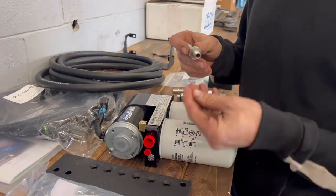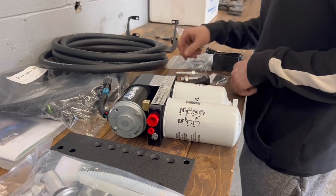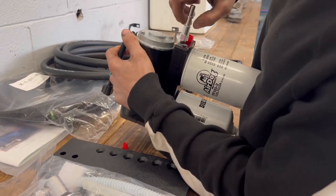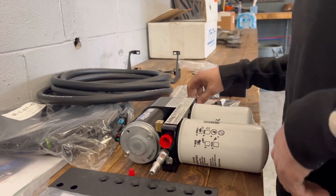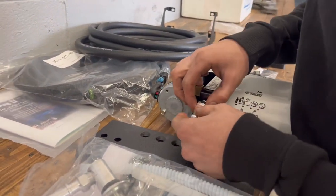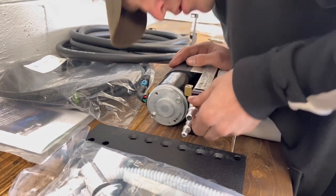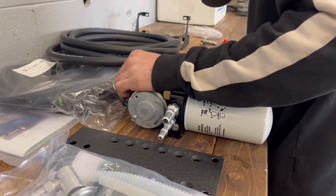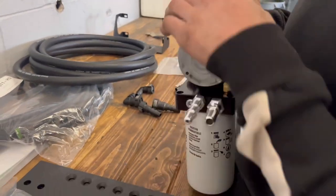First thing — don't lose this. I've lost a couple of them. Put your washer on there and go to your injection pump. Take off all the little inserts, screw this in. You run this one to your engine — keep your hose from here to your VP. Then you run this one to your tank, and this one is a return. Tank and return.